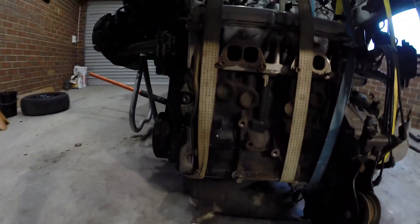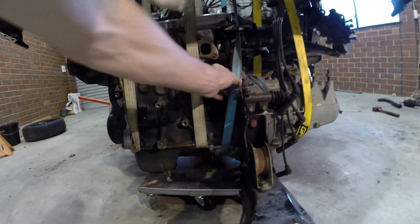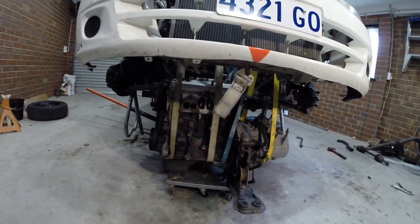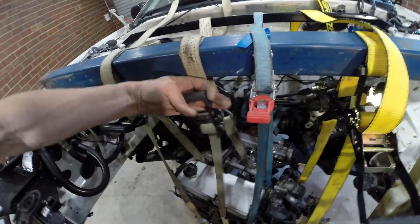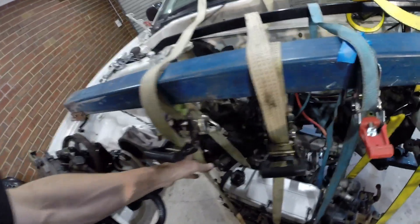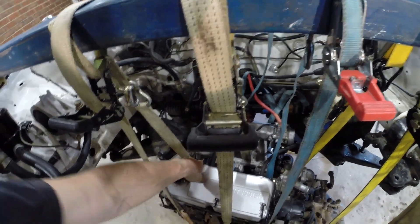So I'll just show you what I've done down here. I've got all the straps tied around and hooked on in different ways, and I've made sure that all the straps are even all the way up so they just go in nice and evenly. I've used four so that at any stage I can take one off and adjust it without a big problem. And you'll see that basically this will lift itself off the ground and go straight up. Just some adjustment — voila, it's coming up off the ground. That'll require a little bit of movement to get it into the right location, might have to adjust one of the straps. But as I bring it up I'll just be able to sway the motor into shape as I come up and it'll come up into the right spot in the end.